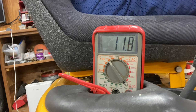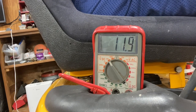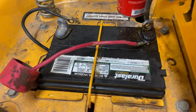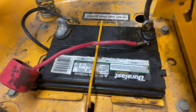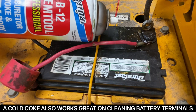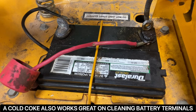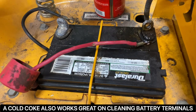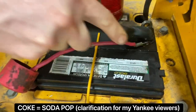So what we're going to do next is go ahead and clean up the connectors, and then I'm going to show you how to actually charge the battery correctly. My very first step — what I like to do is clean off the terminals. What I use is a little American-made B12 carb cleaner. You can use anything you want — make sure you get your safety goggles on. Spray down the terminal a little bit, get yourself any old wire brush, and just give it a good scrubbing.